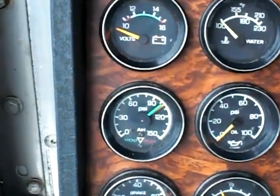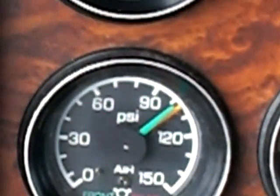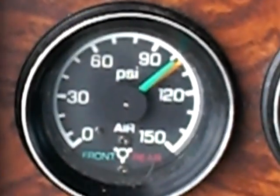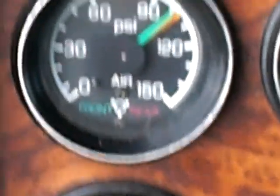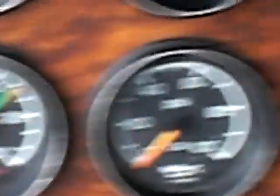We're going to check our needles again. They may have moved slightly, but it's still within 4 PSI, so that's acceptable. I'm going to release the brakes. And once again, there's our brake pedal — if I were stopped, I'd depress them and release them.